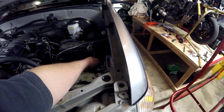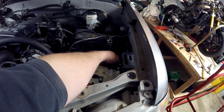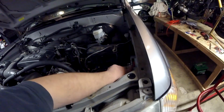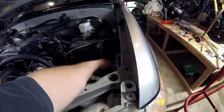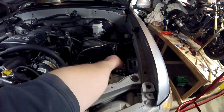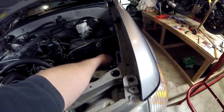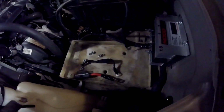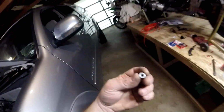Leave your studs out a little bit away from the black pot mix. That's just good for insulation. Plus it keeps all the positives away from the ground of the fins, right? Because the fins are screwed to ground, right? I don't think they have to be ground to work. I think all that's done through the potting. But they're screwed to the chassis, so you don't want that. So you want to pull your base nuts out a little bit to keep the terminals from being near ground. Okay. And I'm going to go find a couple of washers that fit that size.